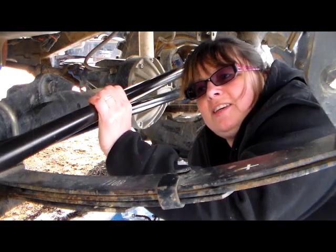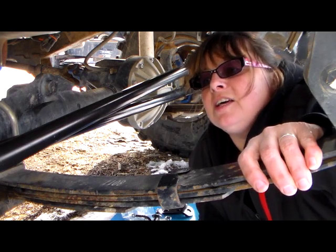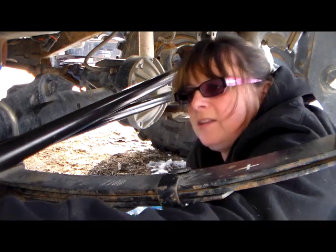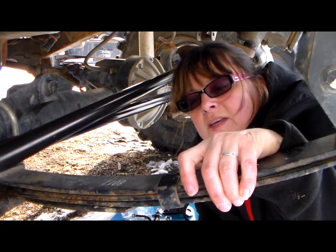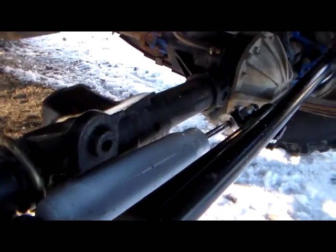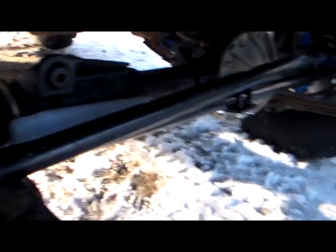I've just set the tie rods in and the member that goes to the pitman arm. I do have my crown nuts on it, but what I need to do right now is lock-tight the ends down here and make sure they're tight — the double nuts that they give me. Then I'm going to work on my crown nuts by torquing them down to 60 foot-pounds as recommended, putting in my cotter pins, and then I can put on my steering stabilizer with the hardware that came with the kit. I've also greased all the fittings, lock-tighted the jam nuts, and double-checked them after I had her lined up.